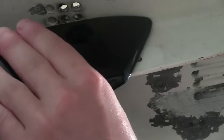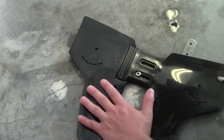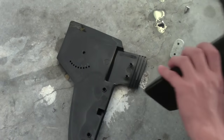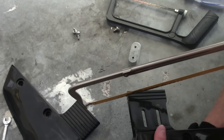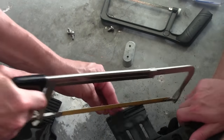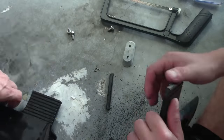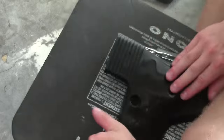The new spoiler fits different size engines — it's good from 0 to 40 horsepower. What they want you to do is cut it down. There are little lines and grooves on it, and you can cut it down in quarter-inch increments. Once you cut one side, you have to cut the other side as well. Here I am cutting a quarter-inch at a time off. It's actually hard to hold without a vice, but I took a quarter-inch off each side.